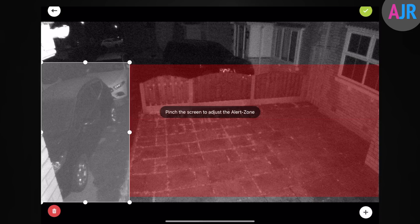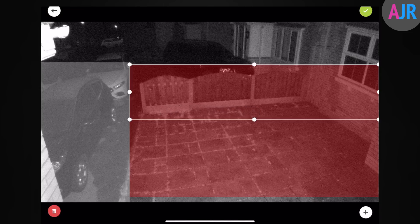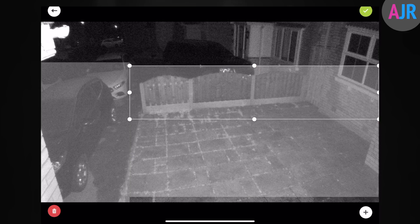While HomeKit Secure Video gives good control, there are some missing features if you're coming from the Circle 2 app. You can't set the sensitivity of the camera's motion detection, which could be a problem for some. You also can't set alert zones — within the Circle or Netatmo apps you can define zones that only trigger notifications if something enters that zone. This is particularly useful for the Circle 2's wide field of view outdoors; without it, you'll be recording a lot of footage and getting many notifications. Another limitation is you can't change or even see the recording resolution, which would be helpful on low-bandwidth Wi-Fi networks where limiting to 720p instead of 1080p would be easier.